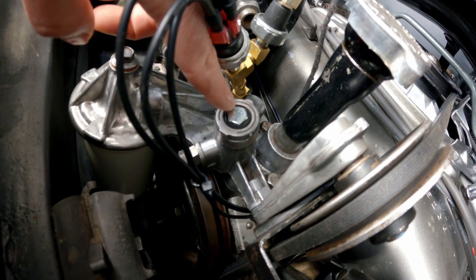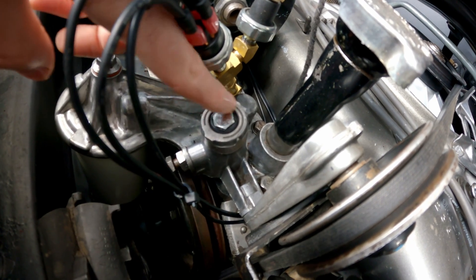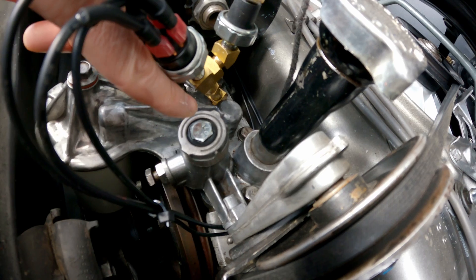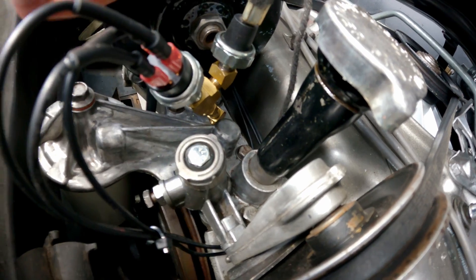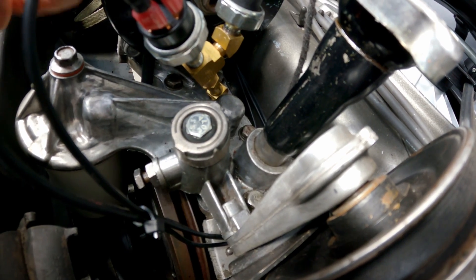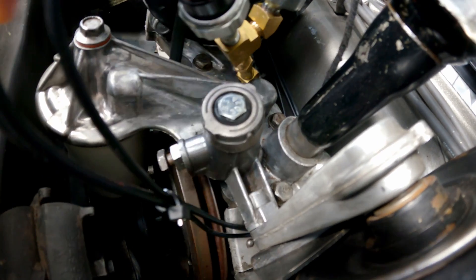What I decided to do was get a little creative and, for free, take my old broken fuel pump, take it apart, grind off the lower flange from the bottom, leaving just the base that plugs in, and sealed it off with a rubber grommet and a bolt. It works as a plug, looks kind of stock, and it's recycling the old pump — which is cool. If I ever want to go back to a mechanical pump, I just unbolt this and drop a fuel pump right in.